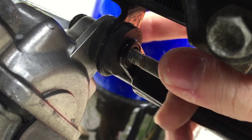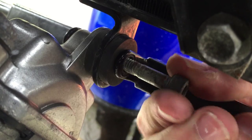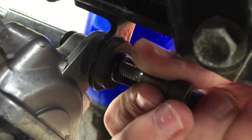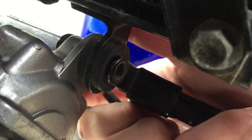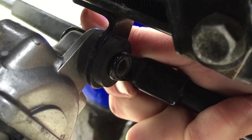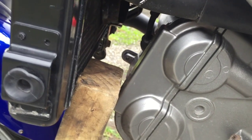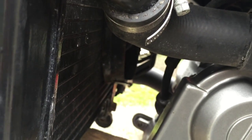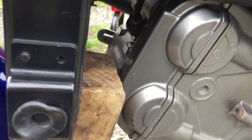It's a pretty long screw, and as you can see on mine because I've got the lower fairings, the lower bracket is coming loose as well, but eventually when that comes clear, all of this just very gently eases off. Coming over to the left hand side of the bike — I've done that because the fan and bits are on the right hand side. I've used a piece of wood to hold the radiator out, and now you can see that front spark plug.